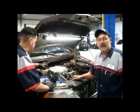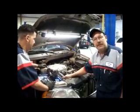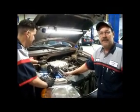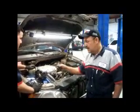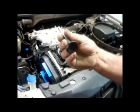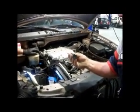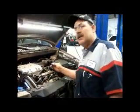It is an interference engine. That's why we're going to show you the timing belt today and the reasons for changing it. Interference engine, meaning the valves inside the engine are in time with the lower part of the engine. If they get out of time, they will pretty much self-destruct from the inside out, and you definitely don't want that on your engine, on any engine.